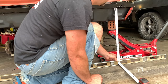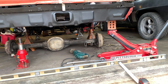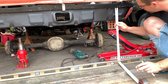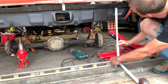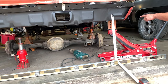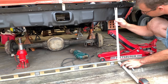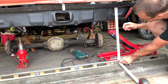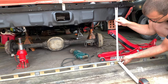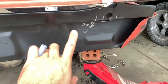Using the little handle on the jack, I'll move that thing up just a little bit. My number needs to be 23 and five-eighths. It's sitting at 23 and a sixteenth shy. I don't want to jack it up so much it starts pulling it off the jack stands in the front. And there we go — 23 and five-eighths. All right, we've got this adjusted to 23 and five-eighths and I'm happy about that.